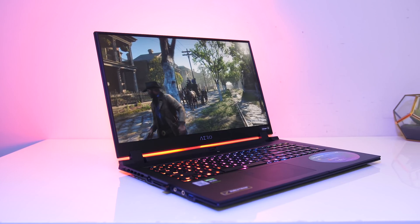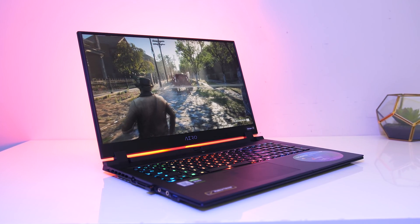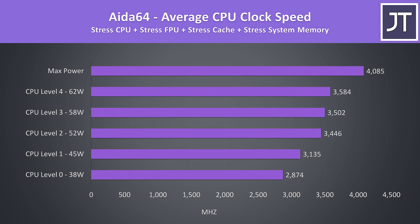If you want to see more gaming benchmarks from this Aero 17, check the card in the top right where I've tested 21 games at all setting levels. Now let's take a look at a CPU only workload — with the GPU idle it should be possible to perform better. Using the default presets in the Gigabyte Control Center software gets us to around 3.6GHz over all 8 cores, however we can improve this nicely by boosting the power limit with Intel XTU.